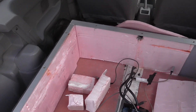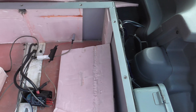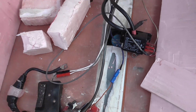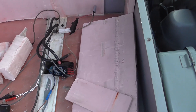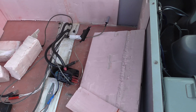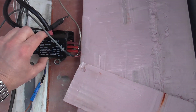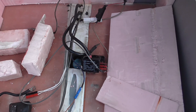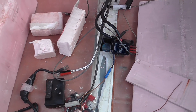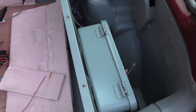In the back here we have the main battery box, which is again in aluminium, welded and bolted through into the structure. These orange panels are the battery heaters. There would have been eight batteries in the back and four in the front for a 144-volt system. We've got some extra stuff in here — I'm not 100% sure about this current sensor — but certainly the thermocouples are associated with this box here, which contains a Campbell data logging system.